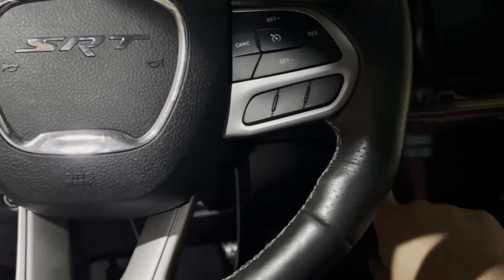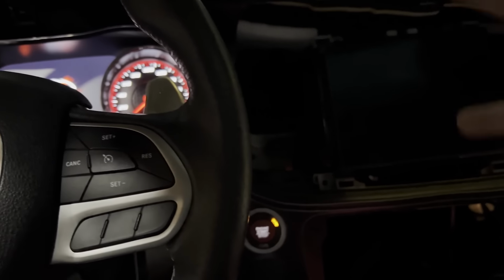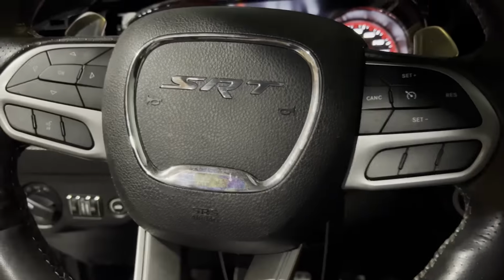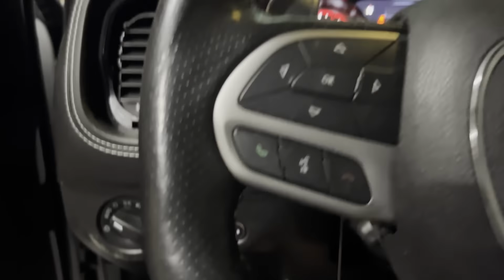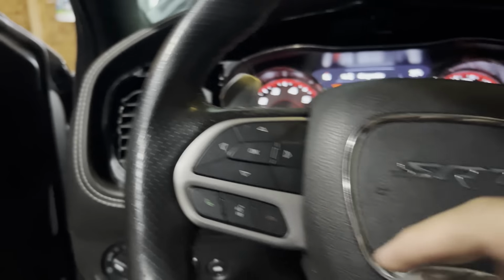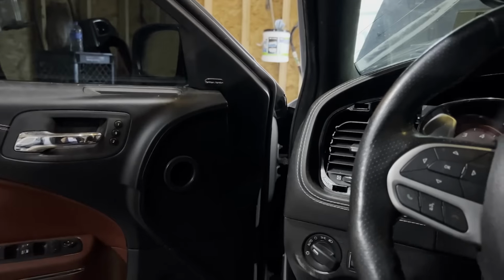But right now, when we get inside of it, it just clicks. And then if you give it a minute, watch this. You're going to hear the cylinder. You're going to hear the actual starter disengage. Right there. So I'm not sure what that means. I just scanned it with my scanner and it's getting no DTCs, so that's not helping either. So let's try to mess around with it. I'll try to cut that piece off, see if we can find any shorts, and then I'll show you guys a 300 and what the plans are with that one.